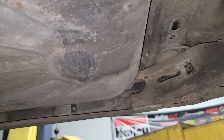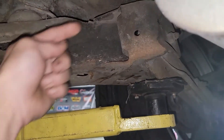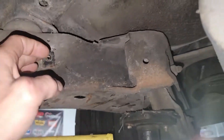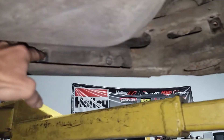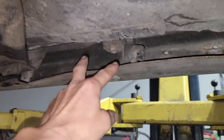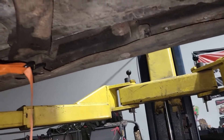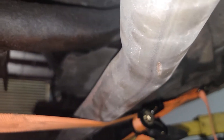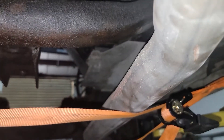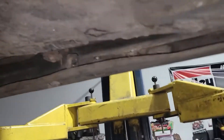I don't like to ever leave anything in the frames that doesn't need to be there, so we pulled that out. My thought right now is I'm probably going to mount the filter here and have the inlet line run above this — just how the factory lines went. It'll come down with like a 45, come straight out the front and into the pump. I might mount the pump right here if it's not too hard to get in there, otherwise somewhere over in this area where there's a little more space. The regulator might mount up on the firewall, and I'm going to do the feed all the way up to the rails, do the crossover, come out the back of the rail to the regulator and then a return line. So it'll have two lines running all the way back.